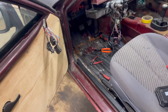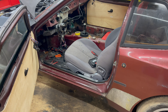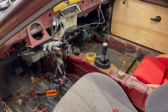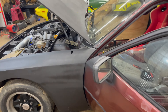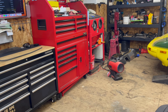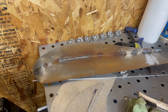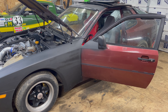I started pulling the rear harness that goes to the tail lights because this one's hacked up from when they tried to rewire everything from the rear to the front. I also got the clip for the shifter so it won't pull off anymore. Let me rip into this harness, get the fuse box out, and then start putting everything back in - this is going to save a ton of time. Since I have the S2 dash, I'm going to cut three holes in it and mount the gauges for now, which means I'll have a fuel gauge and everything else this car was missing.